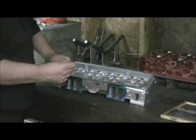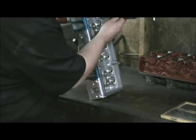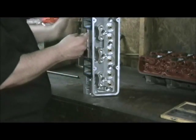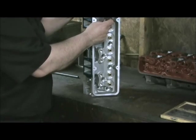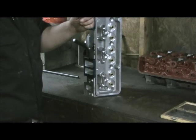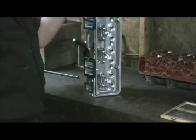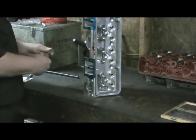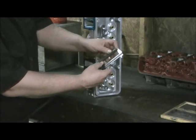Just to verify, what I typically do is turn the head around, slide it through, and just look and see where it's at. I am going to hit a little bit of drive and knock it a little bit below that, and I've got to have that tube inside so when I torque it, it doesn't put pressure on the tube and it doesn't hit the deck surface. So just a few thousandths back — that's our number.